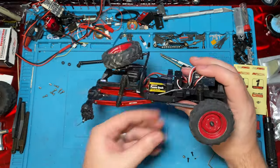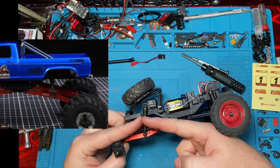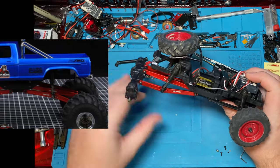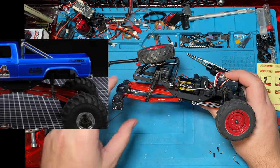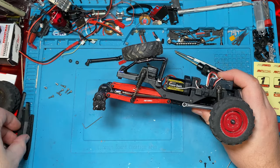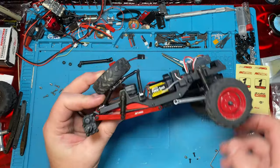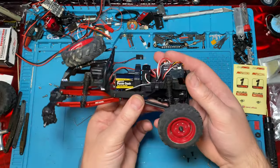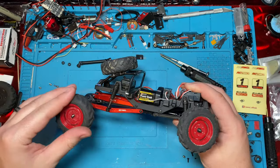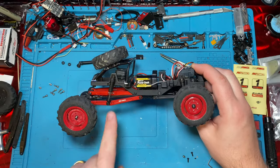Another thing you can do is flip these to the other side so that the link goes the other way, and that'll actually give you more ride height with your shock. So you can actually lift it up in the back if you wanted and basically have like a high clearance link. That's one thing you could do with these links — some people have done it with the VQ links. It does definitely lift your truck. If you don't do something to your front though, it's going to be raked pretty heavily forward.